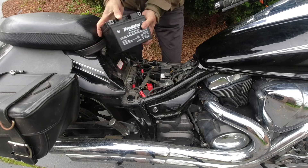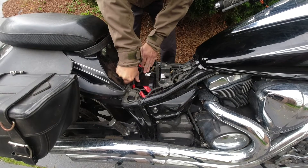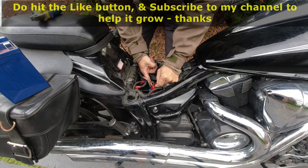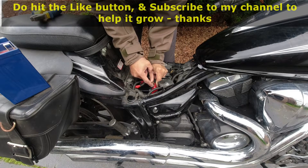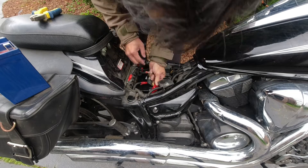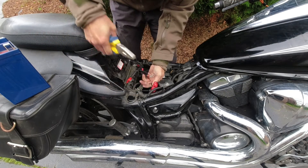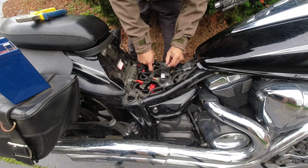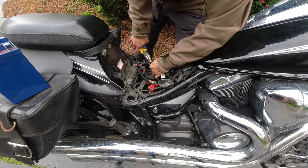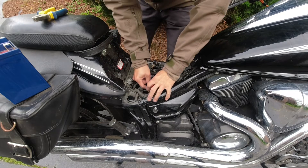Let's put the replacement battery in. Positive terminal to the positive contacts. It seems a little tight but does go in — just means when I have to pull it out it'll be a challenge. I have a problem fitting this connector to the terminal because on the connector there is a side wall, but on the replacement battery that wall gets blocked going down fully, so I have to either cut it or bend it. I will attempt to bend it using a pair of pliers and bending it flush. That works. I'll have to do the same thing and bend this on the negative terminal. You can see that bend upwards now and that will fit. Just a little bit of customization.